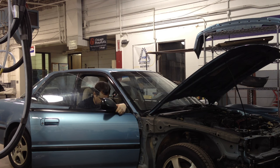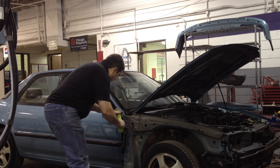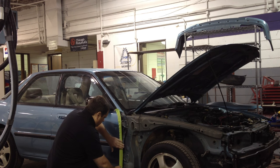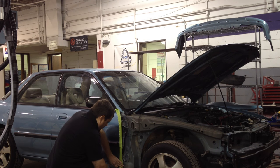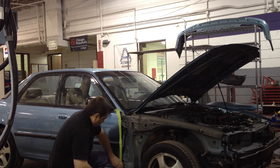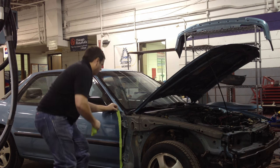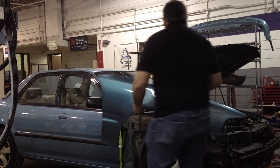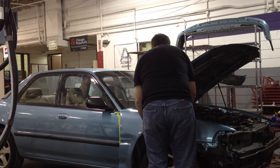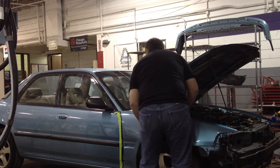Because buffing really does take a lot of time, especially if you just did a complete paint job. What I'm doing now is protecting this door, because we're about to put the fender on. Last thing you want to do is damage one of the panels you just painted — then you'll be redoing it again. So I'm getting some tape just to protect that edge in case I bump it a little bit installing the fender. Now I've got the fender and I'm gonna put it on — I just set it on there and kind of adjust it the best I can.